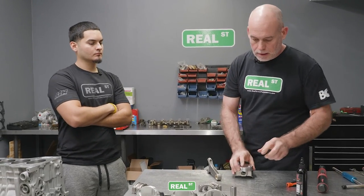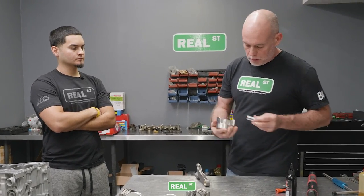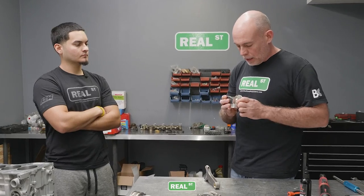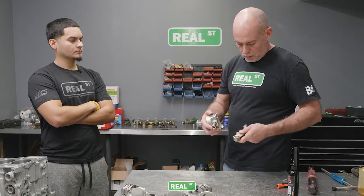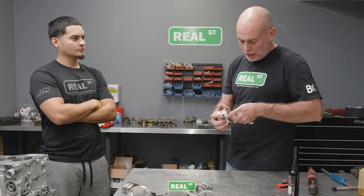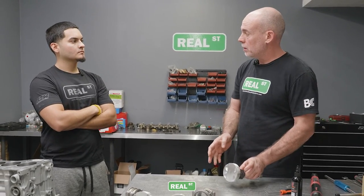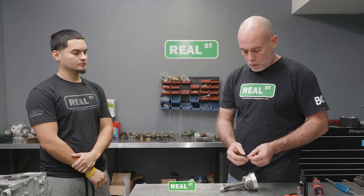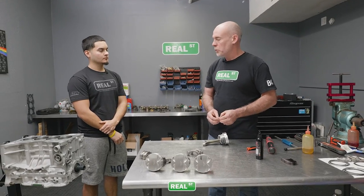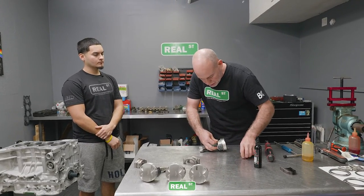But again, they used to have cars with factory forged pistons, and there's some alloys out there, like the Dodge Hellcat has a piston that's kind of a funny OEM level alloy, and they deal well with boosted applications. But in the aftermarket, you can get a low expansion alloy, like a 4032, like a Supertech piston, like I have in my B series, or you can move to a 2618. If you have a boosted engine, you just buy a 2618. It's just a much stronger part because you're gonna mess up.